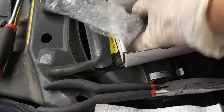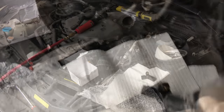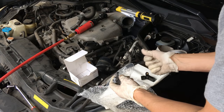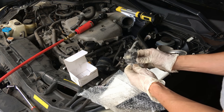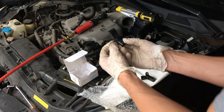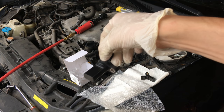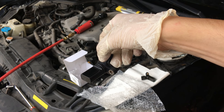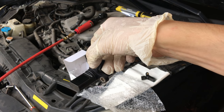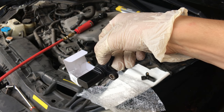Out of the box there's a good amount of bubble wrap to protect the part during shipping, and it's also in a plastic bag inside. You can see it is in fact the same part. Here's the new camshaft position sensor — going to do my best not to get it dirty. That's going to insert on the back of the cylinder heads, just under or right over the camshaft, and it senses what position the camshaft is in to help with the ignition process.